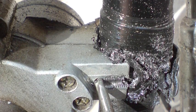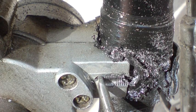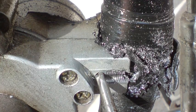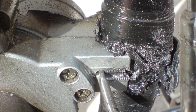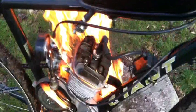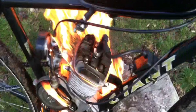There are some two-strokes out there that are built professionally. However, you're still getting into the same thing. Smoke, noisy, a lot noisier than a four-stroke. You're mixing your gas and oil all the time. You have to get your ratios right on. If you don't, too little oil, you'll burn your engine up. Too much oil, you're going to run into performance issues and have even more smoke. So, still not keen on them. There are other formats of four-stroke engines that offer more power and more speed than a two-stroke. I'll get into that towards the end of the video too.